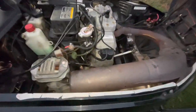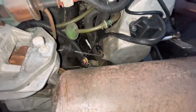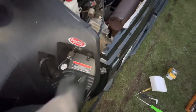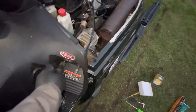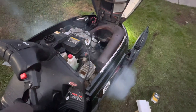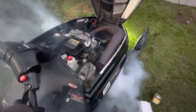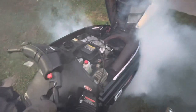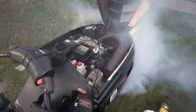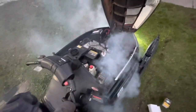Alright, we got our new coil in, got it mounted, got our spark plug boots on — the grommets — got the wiring situated down there, away from the pull start. We're going to hit the choke. That is the quickest it's ever fired up though.